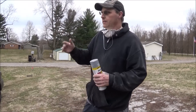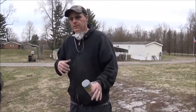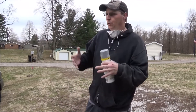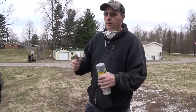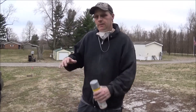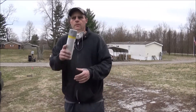Hopefully by the time I get this all done for the preliminary sanding and priming, I'll have a compressor and a paint gun and I can get some good high-build or sandable primer. I'm thinking high-build primer — that way whenever I block it, it'll smooth it out even more. So I'm going to show you what I've done today and explain things as I go along, so stay tuned.